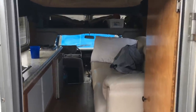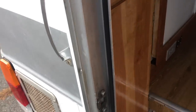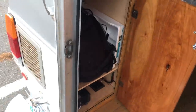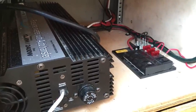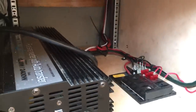Here's a little overview of the interior. The couch is on the right side and the table and stuff is on the left. Starting from the rear — this is the only cabinet that opens to the outside, enabling you to open it from the exterior. I store things in here that I haven't really used: some basketball gear, a little extra storage unit, and a battery charger. Down below is where all the electronics are — there's a 1200-watt power inverter that converts DC to AC to power devices that run on a wall outlet. There's a big six or four gauge wire that goes all the way to the front coach battery.